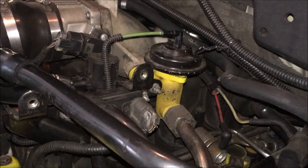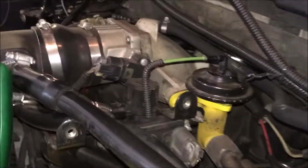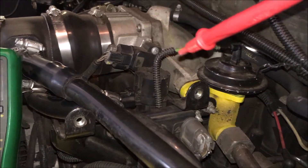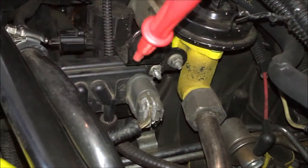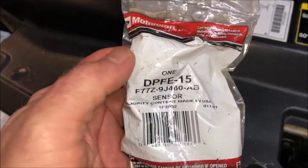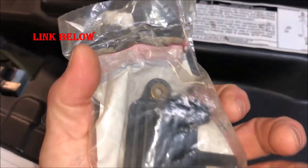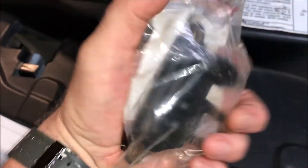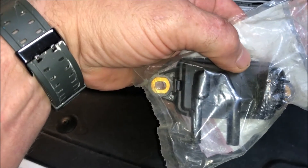Given all these tests, I feel confident that the EGR system mechanically is good — good EGR solenoid, good EGR valve, good passages, good connection to the EGR tube. But the DPFE sensor has tested bad and I need a new one. I received my Amazon Prime-sourced DPFE sensor after a couple of days and I'm going to install it now to resolve the DPFE fault.